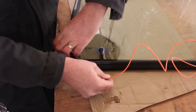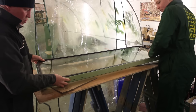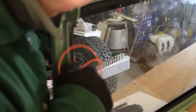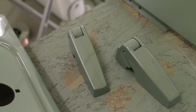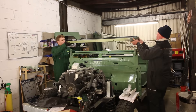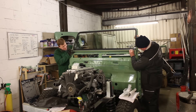To fit the new seal, place it onto the screen, then feed a thick cord — we're using strimmer wire because it's very strong — into the rear seal lip. Get it as close as you can; you may need a credit card to feed the seal around the front. Then pull the strimmer wire out at 90 degrees to the windscreen, which pulls the rear seal over its retaining lip and seats the screen. You can use silicone lube to help, but be careful not to crack the screen. We're also retrofitting old-school Series 3 and 90/110 fold-down windscreen hinges so we can drive around with the roof off.